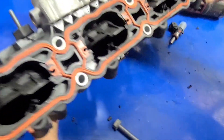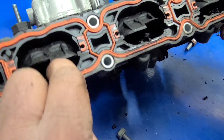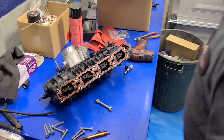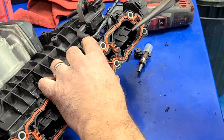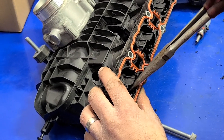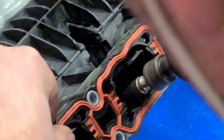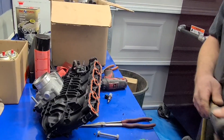On the other end, go back and clean off all the little burrs left when the drill bit poked through. You can first just break them off with needle nose pliers to remove the big chunks, and then you can get a little die grinder to clean it out properly. Now we've got that cleaned out.